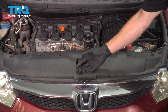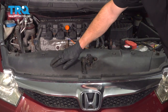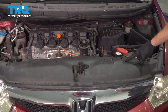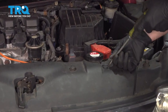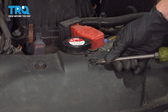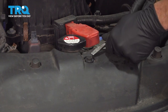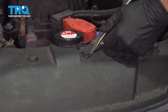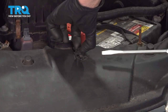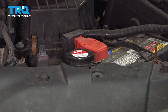The first thing you want to do is have the hood in the upright position. Once you've done that, we're going to be removing this trim panel. To remove the trim panel, you'll find that you have two plastic push clips. Come right in the center and remove the center from the outer portion — it should just lift up a little bit into the unlocked position. You can use a trim tool or flat blade screwdriver. With it unlocked, make your way underneath the outer portion and lift that up as well. Give it a quick inspection, make sure it is still reusable, and do the same to the other side.